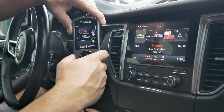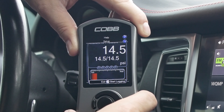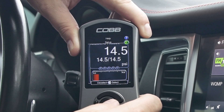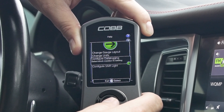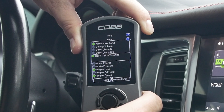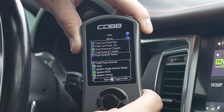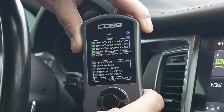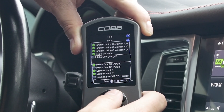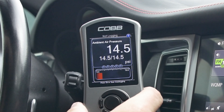Data logging is a pretty simple process with the Cobb Access Port. There's the gauges menu — we're going to click the center button to continue. This is going to load up basically the data logging capability of the Cobb Access Port. To set it up, we will send you a list of attributes to log — usually out of the box is fine, but we will send you that list. If you need to make any changes, there's Configure Data Logging — just click OK. These are all the monitors; you can go down the list. Green means it is logging; if it's gray, it will not log. Here's one just to show you — Intake Cam Actual — we're going to just enable that. Then we can hit the back button.